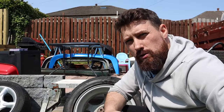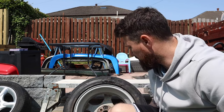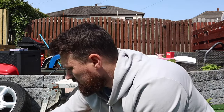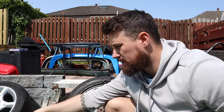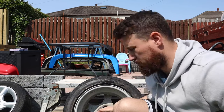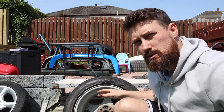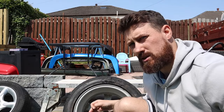Once you've got all that wheel weight glue off, the next stage is getting everything really as clean and scuffed up as possible. To do that, get some grey scotch brite pad and a bucket of soapy water. You're going to go around the whole wheel and the objective is to get the wheel as dull as possible so that you're ready to start painting it or doing any repairs you want to do.